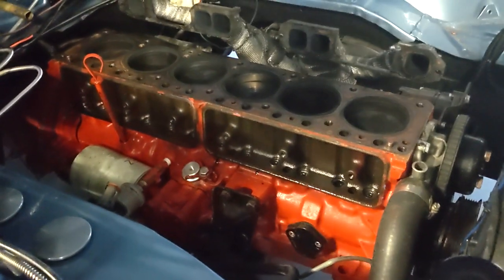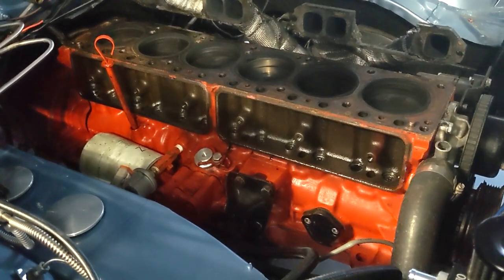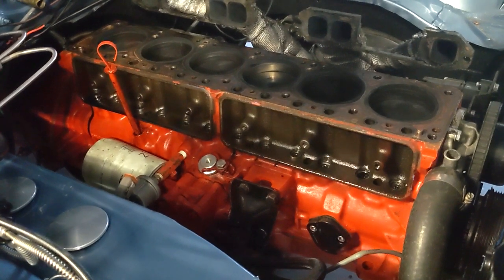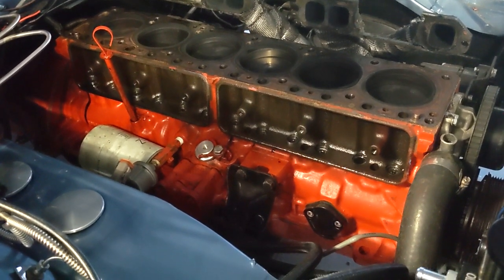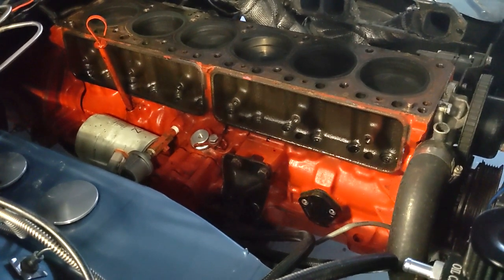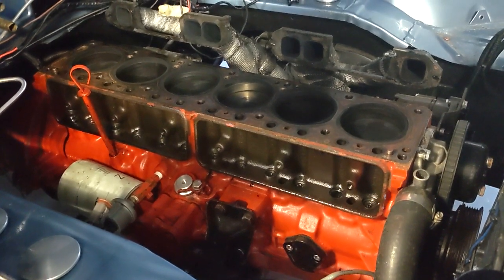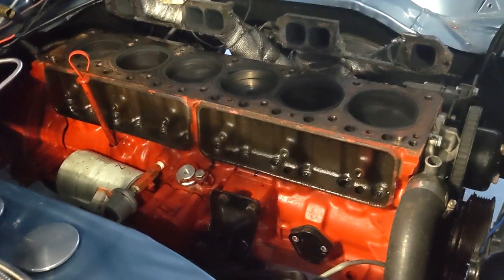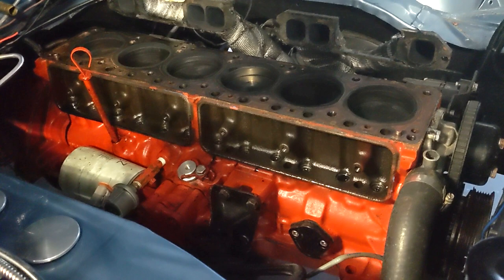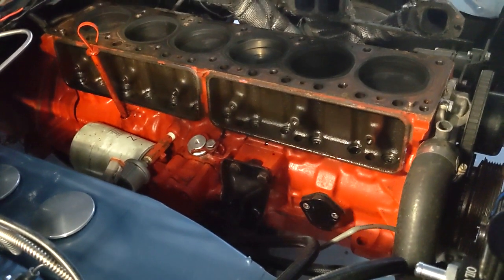One of my areas of concern was the hydraulic lifters. I've just taken the side covers off the motor and I'm going to pull those lifters out and check them out. I was concerned that a bit of silicon gasket goo may have got into the oil system and possibly blocked up one of those hydraulic lifters, which would account for the tappety noise I had in the top end. A few people suggested about the high-rise rocker cover and I have purchased one of those for the new build, so that will negate that issue as well.